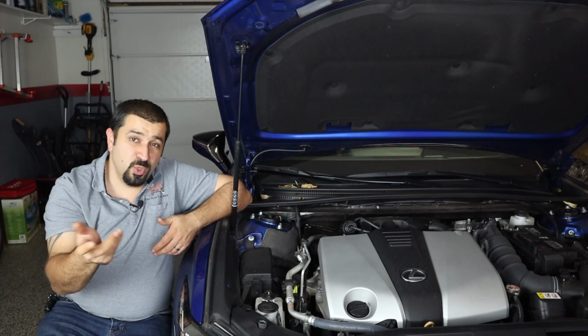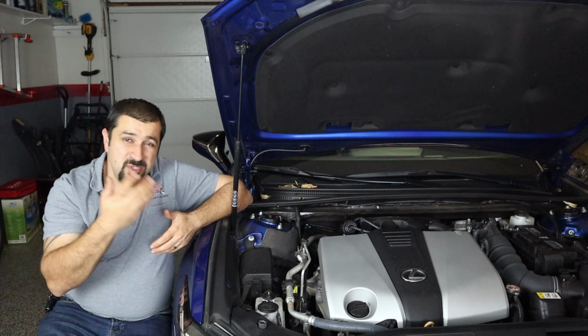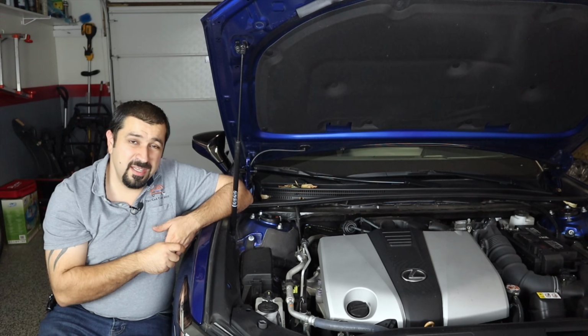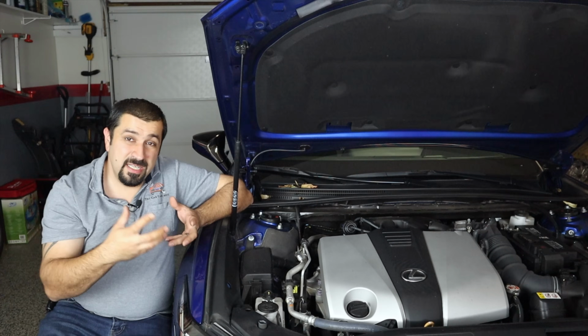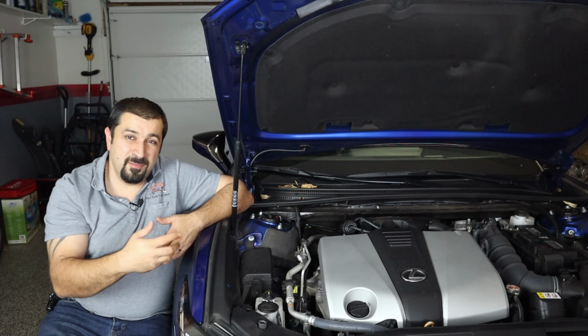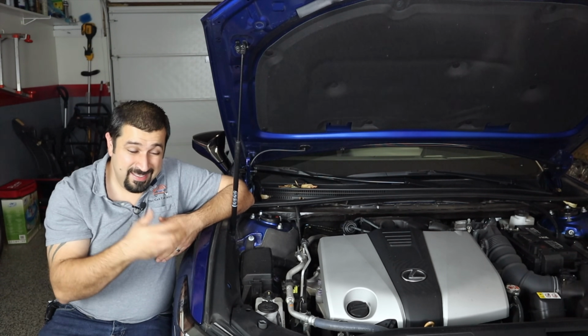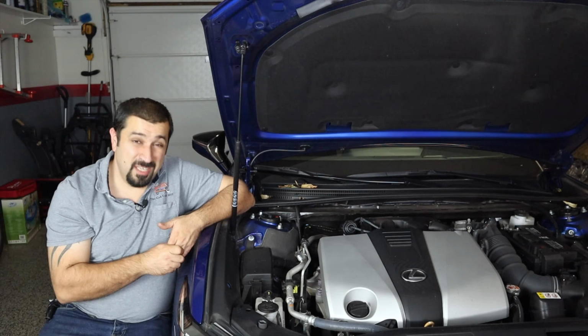They no longer make noise. You called it a day, shipped the car. But those leaves, as soon as you turn that blower motor, some of them got chopped up and thrown right into the AC box, the HVAC box. And then guess where they're going to collect at the end? At the very bottom. And guess what happens when it collects at the bottom? You clog the drain of the HVAC system.